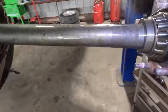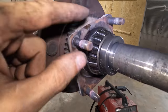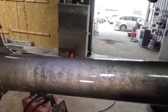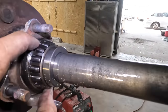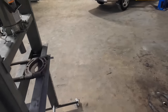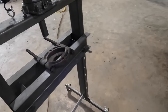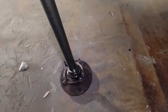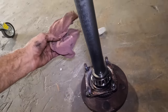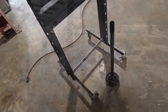Let's get a closer look at how this is functioning. We've got our flange, we've got our bearing — looks like a bearing spacer — the race is in there. We're gonna have to pull that out with a slide hammer and this has to go over to the press so we can press this off the axle. We're rolling the press over from the corner — the corner is full of Subaru parts and it's really hot over there. We need to set these axles up in the press and press the axle off the bearing and seal. I hope the press can accommodate these axles.